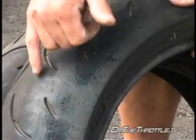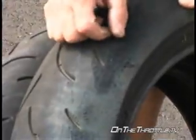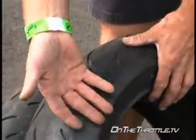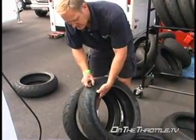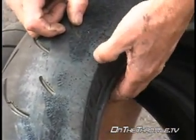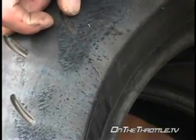And this is actually physically the oil in the tire that keeps it fluid bleeding out of the tire. So every time you heat cycle a tire, the oil comes to the surface. Because of that, what will happen is it'll change color like this. The more you go through the heat cycles, the more the oil bleeds out of the tire, the harder it gets. So in this instance, you put your fingernail in it, it's supposed to spring straight back out and not leave an imprint. It's still there. So this tire's been through plenty of heat cycles.